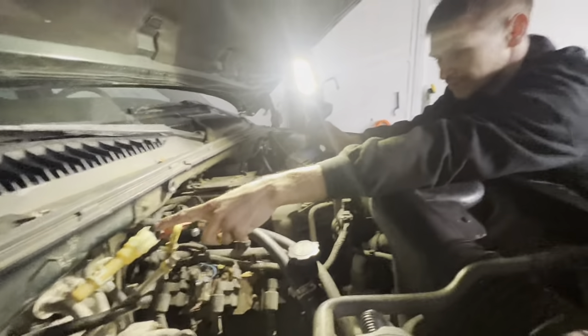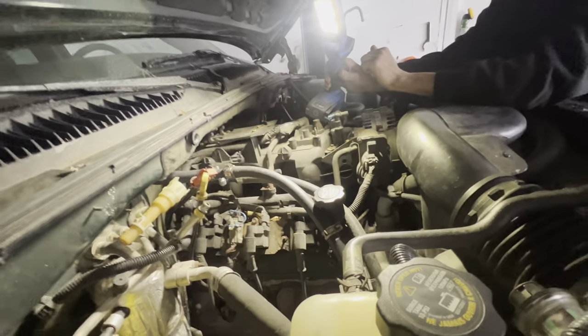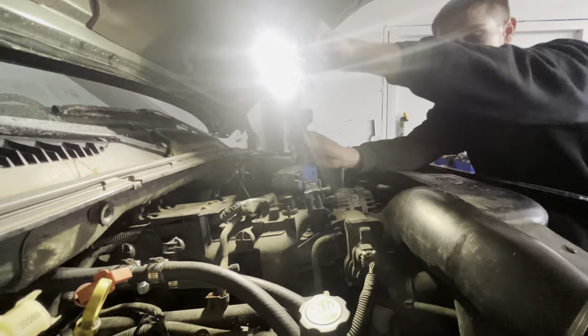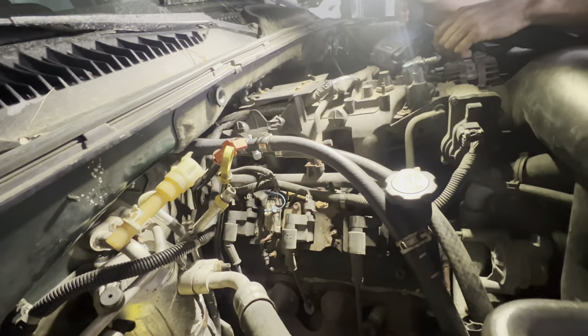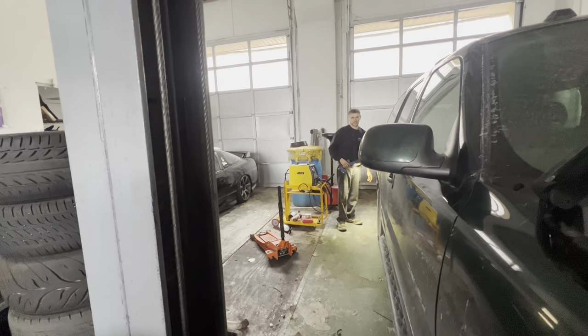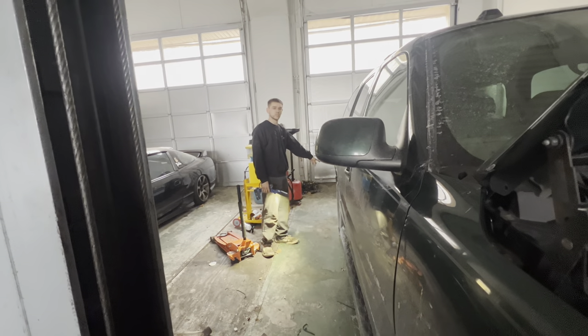Oh, my repair is still holding — all of your coolant lines. So when that went out, I had this still bent over to here, so whenever I would stop, coolant would come up out of here and hit the manifold. Those are the rear lines — there's a core in the rear. Those aluminum lines along with the AC lines run all along the side of the frame. This would go on there and the line would intercept it.